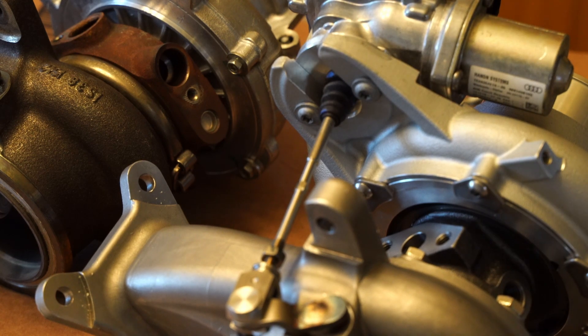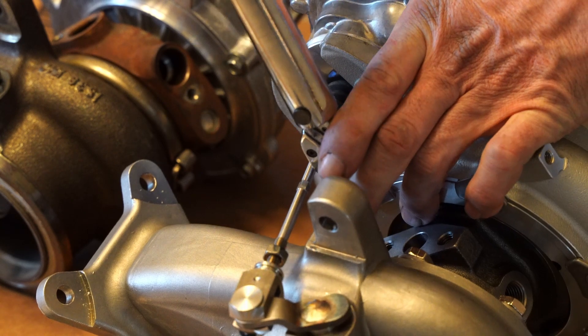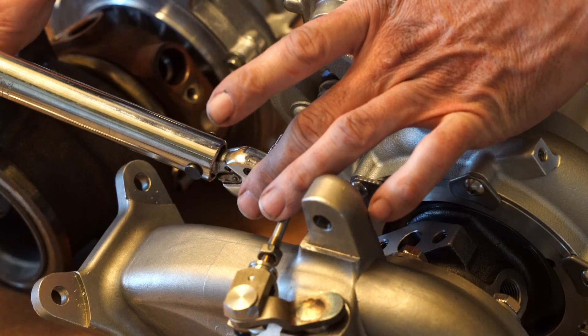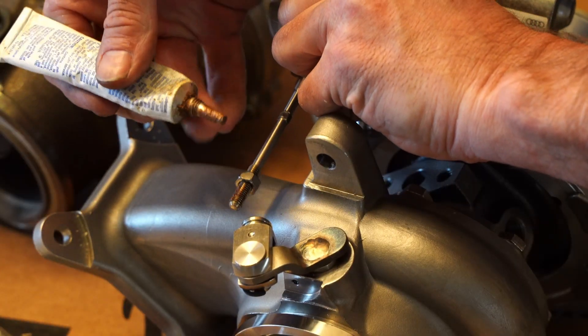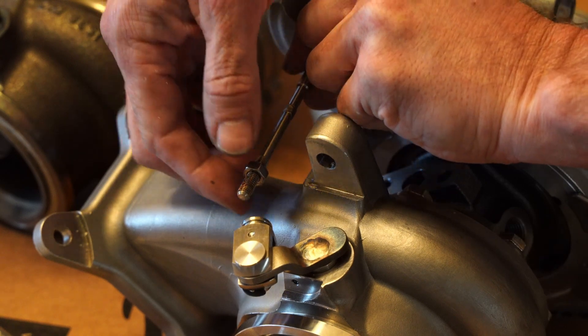So I'm going to do it on the bench and show you how. If you were doing this process on an IS-38 style actuator — you would know because it looks physically and distinctively different — the process is exactly the same, except you don't have to manually force close the actuator. You can just apply power and it will be in the closed position, then check voltage. Alternatively, you can also do it in the car.